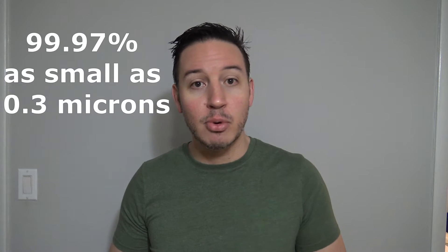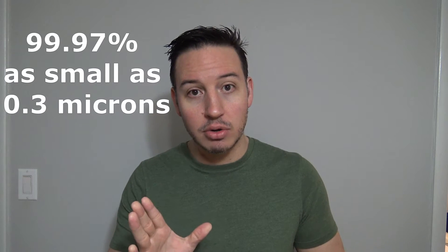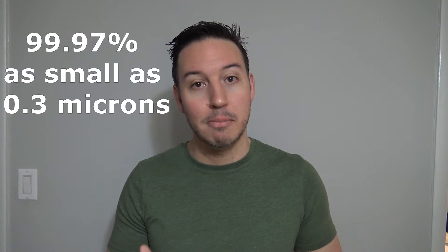I'm going to help you identify that in this video. You want to avoid manufacturers who play fast and loose and make vague, meaningless claims. It might say HEPA-like or HEPA-type, but they don't give you any actual numbers. Or the box might say it traps 100% of dust mites, but they don't tell you anything about filter efficiency or particle sizes. A true HEPA filter will always quote the numbers — 99.97% of all particles as small as 0.3 microns.